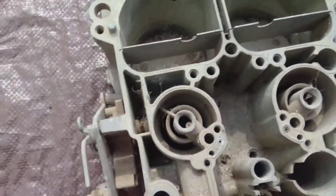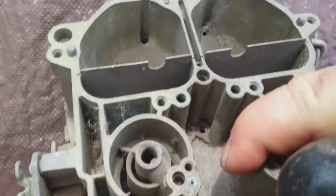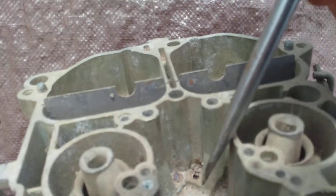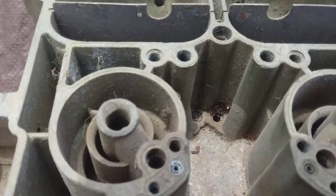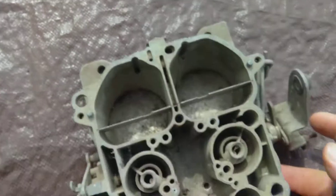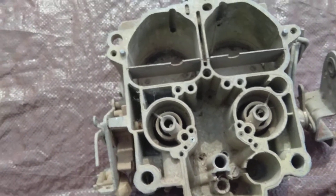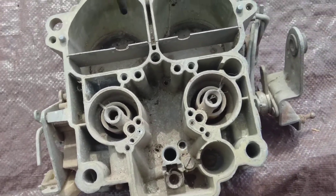The secondaries are back in the back here. Those back in here, you can open up a little bit so you can use a regular metering rod, and then you don't have to worry about turning those down or not running them at all — because you should run them. They really help.